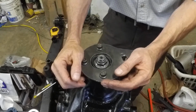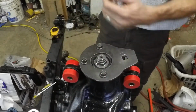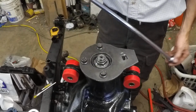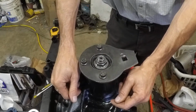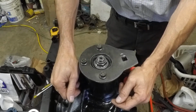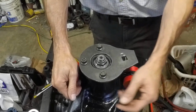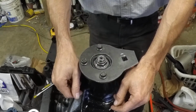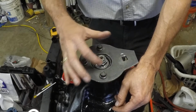I tried to crush it with long bars here and on the nut, and we're talking 24-inch breakers like this size, and man, it just would not. I just didn't have the beans to do it. And so we went back to the impact, and ever so slowly, my weak little impact has very slowly brought it down. So we're getting there, but I'm gonna tell you, this crush sleeve is ridiculous. Got so bad at one point I was concerned something was not made up right. I took it all back apart, checked the pinion, everything's fine, which now means I also got to put a new nut on here. So I've not over torqued the crush sleeve, so I don't have to replace the crush sleeve. But once I get this thing very close to the right torque, I'm going to replace this pinion nut.